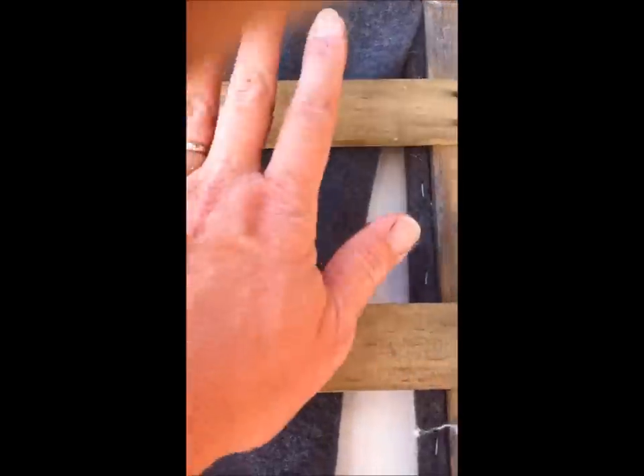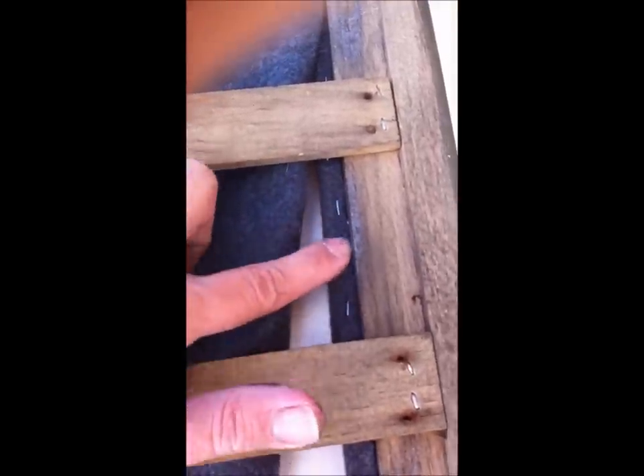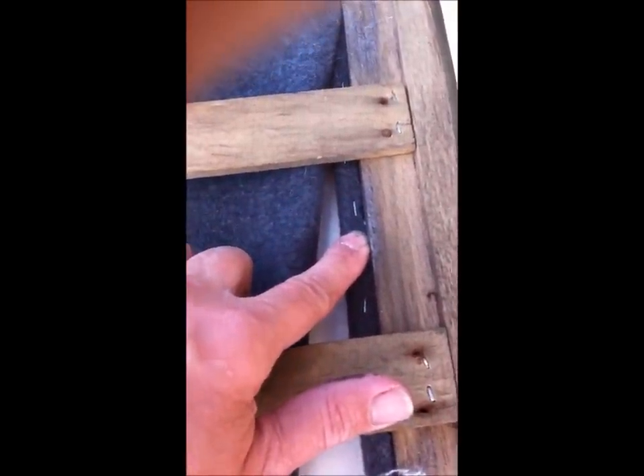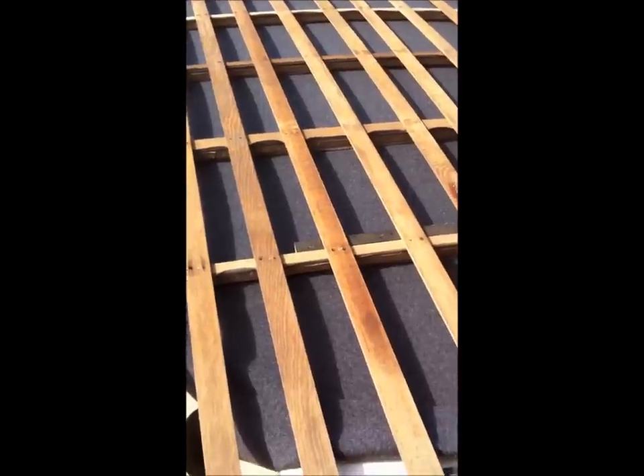I am beginning the front part. I fold my fabric over, and if your wood lattice is in place this should slide right under there. Hopefully nobody has nailed their wood lattice to this groove — there is just a fine notch in the wood and that is where all your stapling is taking place. We fold the fabric over and then stretch it into that groove, watching for all of these seams to tighten up. You really want to stretch as much as you can, especially because these cars have wool headliners — if you leave a lot of saginess in at the beginning it is only going to grow in humid weather.